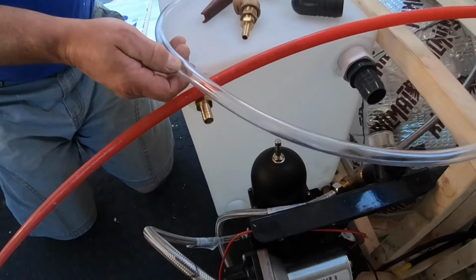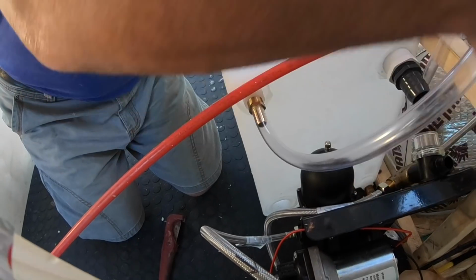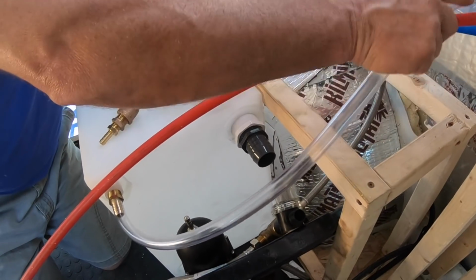Once we had that in place, Tim actually came over, our neighbor, and he's a plumber, and he was able to grab some products that he had in his truck, and we could maybe just do some dummy lines. The 1/2-inch hole on the top was our breather line. In order to fill the tank, you have to have water or air able to escape, or else you'd just be spitting water back out at yourself.